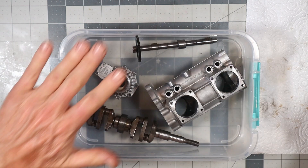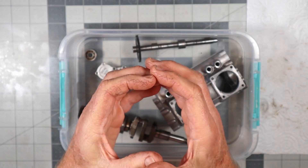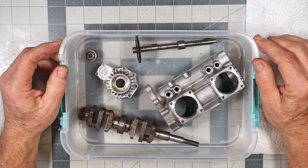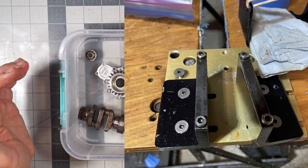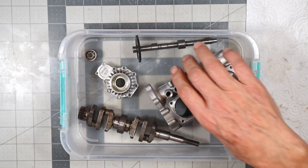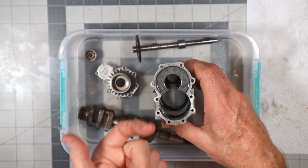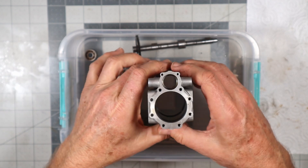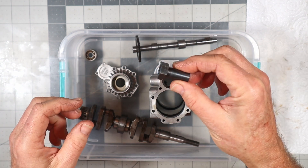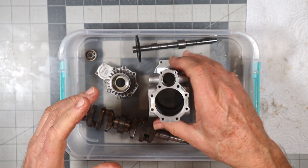Basically what I did was take this entire thing out there with the front housing still on, held together with four screws as I mentioned in the last video. Since I don't have a big wood vise anymore, I used my PSP test stand. I'll put a picture up showing how I configured that stand. I lined the top with some blue painter's tape to protect it, angled it so the bearing and crankshaft could come out, and put the prop nut on the crankshaft as the surface I would tap on — with blue tape on that also.